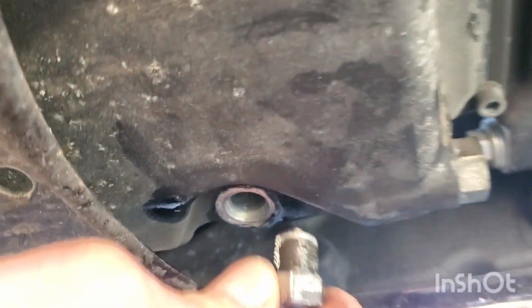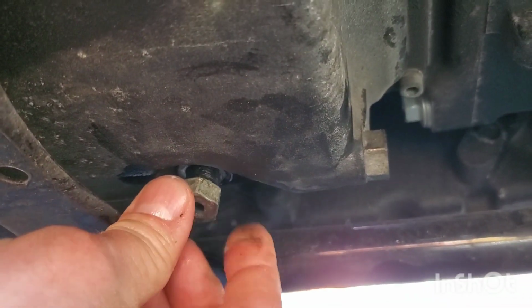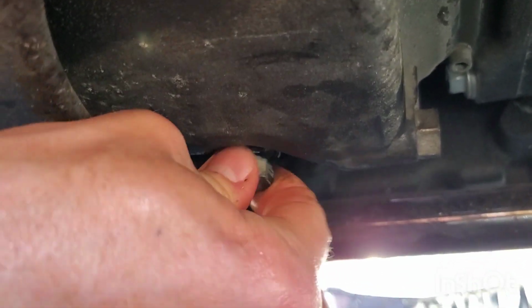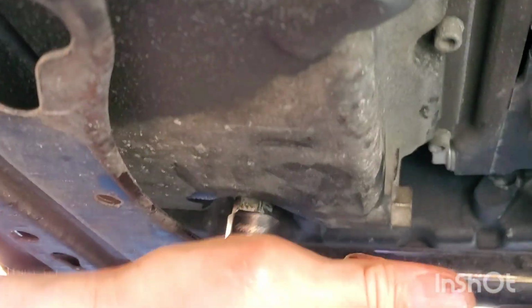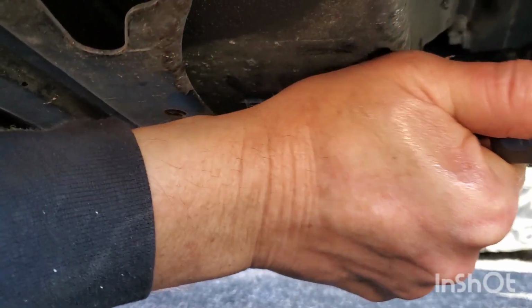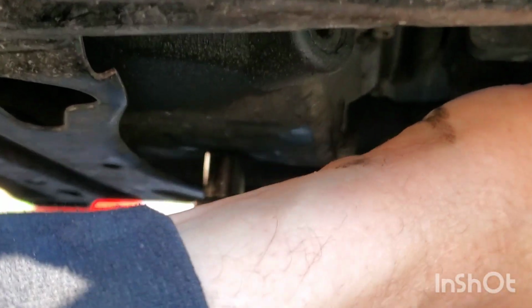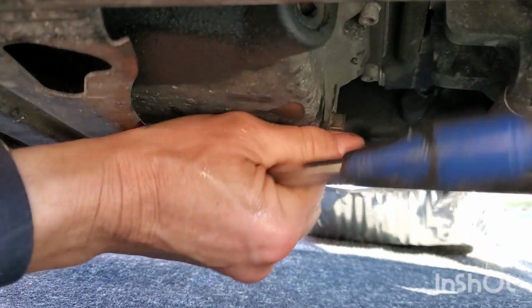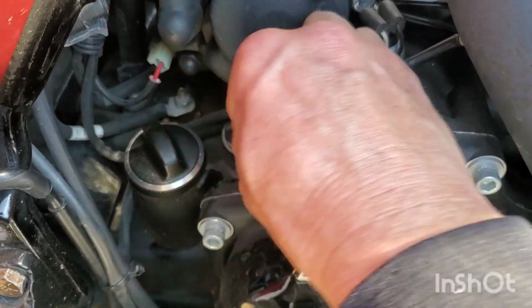All right, moving on. This time we're on this side of the bike. Got a little pipe dope on there, the new rings on. 14 to 21 foot-pounds. Oil. Click, click, click, click. Or for your digital guys, beep, beep, beep, beep. All right. Now, you know what? I'm gonna put 28 ounces in there. We'll fill that right away, and then we'll do the oil. So, 28 ounces.